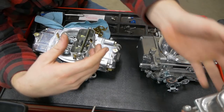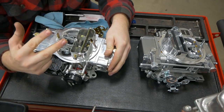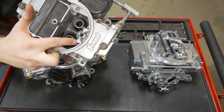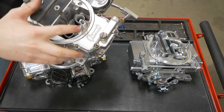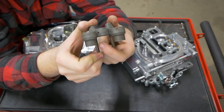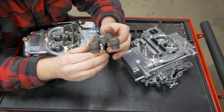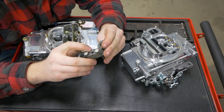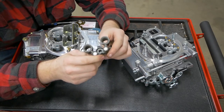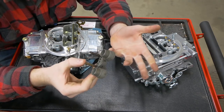You will see more and more carburetors starting to run annular boosters — like the Edelbrock AVS2 is an annular booster. On some carburetors like the old Autolites, Fords, and Summits this booster assembly can actually be removed and there's a weight in here under this screw that's super important. This weight is here for the accelerator pump. These are the accelerator pump nozzles right here — if that weight's missing it will do some crazy stuff. Right in here are two jets behind these two holes. These can be changed to tune your accelerator pump shot size if cam changes aren't quite enough.